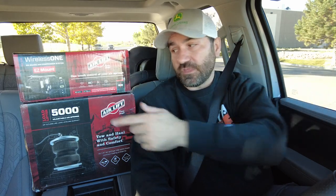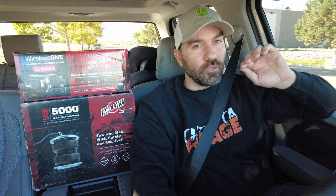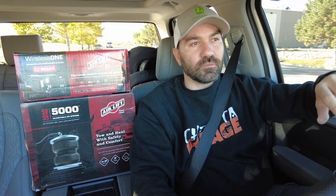With the airbags aired up to about 89 to 90 PSI — almost maxed out — the truck was completely level. Surprisingly, even at 89–90 PSI the ride was just a little bit harsher than stock, but barely noticeable. Someone who hadn't been in the truck before wouldn't even notice it. The trailer came in just around 8,000 pounds, it's about 11 and a half feet tall and 8 and a half feet wide — a really large RV — but the Tundra did perfect.